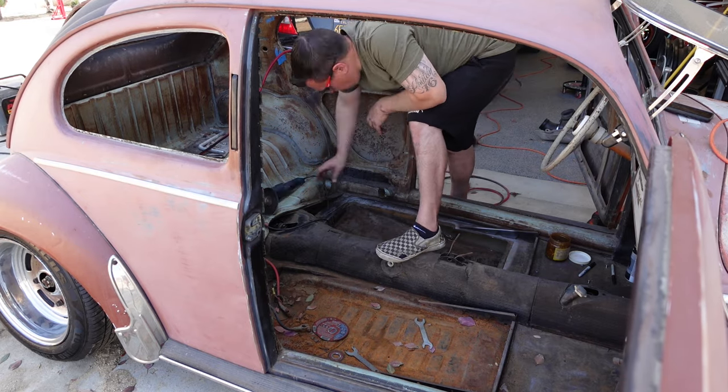That side I already primered. This side I got it welded in. I basically plug welded all back here. I ground off any of the high spots. I tack welded the areas that don't overlap, which is basically just from here to here and here to here. On the tack welds, they're not proud, so I didn't grind them down, just to keep the strength on it. I vacuumed it, and then I went over it with Windex. So I'm just going to primer this side, and that should complete it.